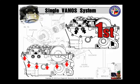There is the first thing you've already accomplished. The second thing is removing the six mounting nuts at the front lower half of the Vanos. Remember, on that M52 motor, the second nut from the left and the first nut from the right you already removed, so you can get the vacuum line forward. Cover the belt and lower radiator hose to protect them from the deluge of oil that's going to come out of the line, the Vanos, and the solenoid. You don't want to make a mess of the belts and hose, because oil doesn't mix well with rubber, and that could be a problem later on down the road.